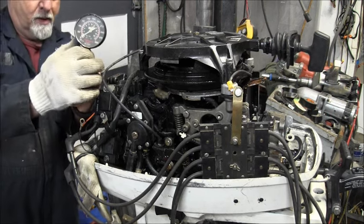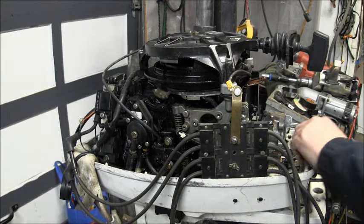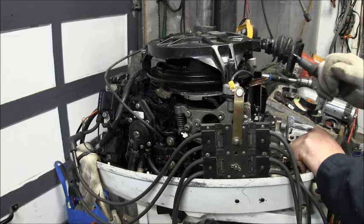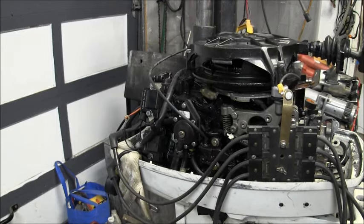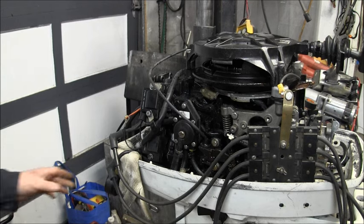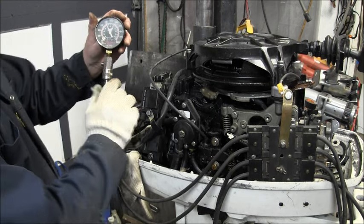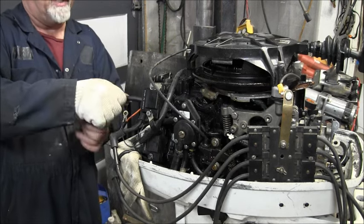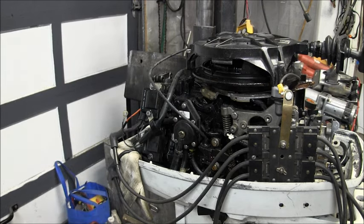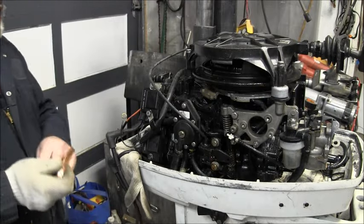We're on the top. Zero. Let's get four or five good ones here. Five good ones. Forget what we get. About 120. No, I'd say 118. Those are good numbers. And this is dry. Very dry. You saw those spark plugs I pulled out of here. They look like they've been sitting out in the whole Mojave Desert. All right, we got good spark.